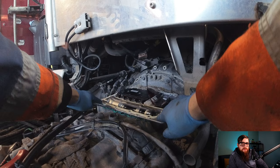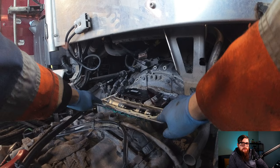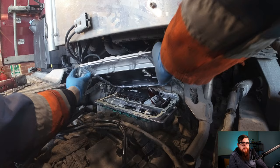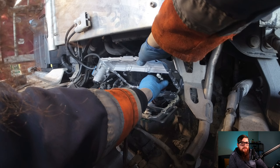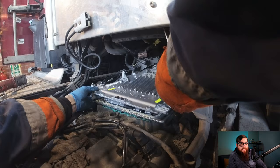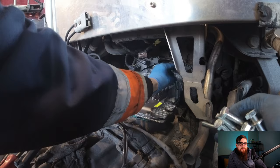Access doesn't get much better than this on a tractor unit, but it's not always this way — you can't beat wedging yourself between a bin wagon body and the cab. If it's sat on the detent springs and you have some bounce in the modulator, you're good to send it. So with the gasket lined up and the ECU plugged back into the solenoids, we can get this tightened down. You have 10 solenoids in there which operate your splitter, gate, main, and range positions. The truck does have another 4 solenoids, but they're fitted into the clutch actuator.